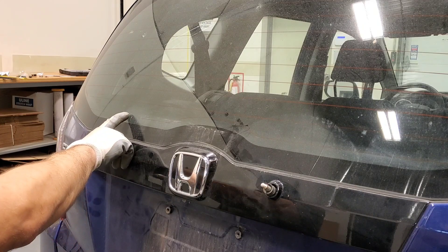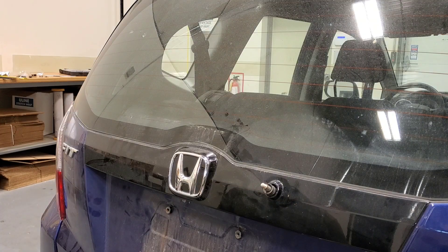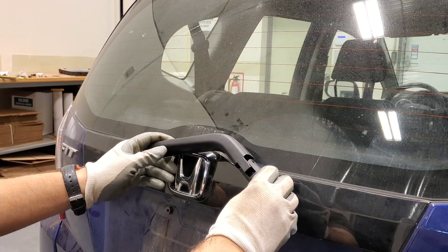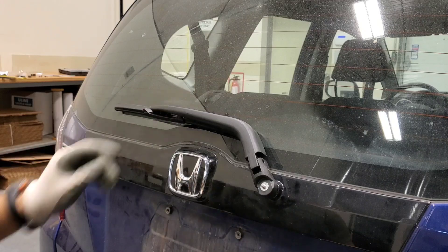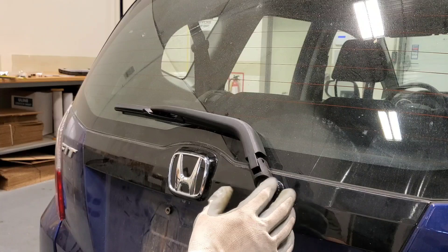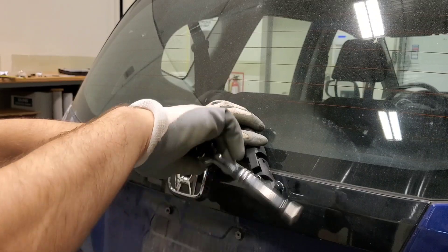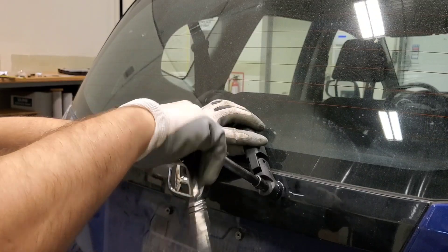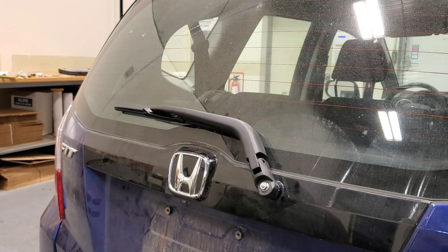The old one was right here. There is a line about a quarter inch above the heating line. If you're unsure, just use a piece of tape to mark where it was. I'm going to eye this out, but with common sense — if it's like this, it's no good. So it was about here. You hear it click on. Then we'll tighten up the nut — hold it in place, tighten it up until you feel resistance and then give it another quarter turn.